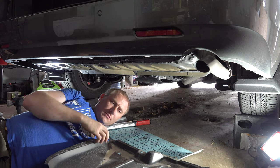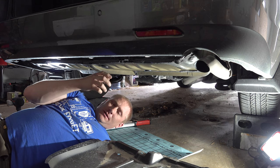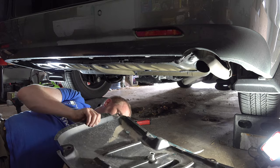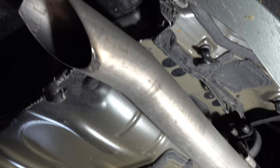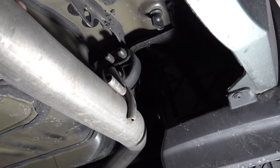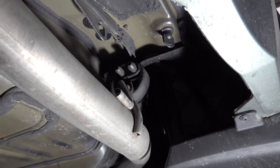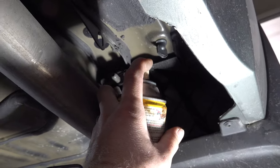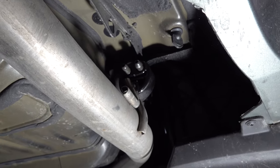That was relatively easy. On those last four big fasteners, putting a little bit of downward pressure definitely helps — that would be the one thing I'd say. Now that we've got that down, there is a rubber grommet here that is basically the absorbing item for the muffler exhaust. I'm going to spray that with some silicone spray, so it comes off easier, and probably do the other side too.